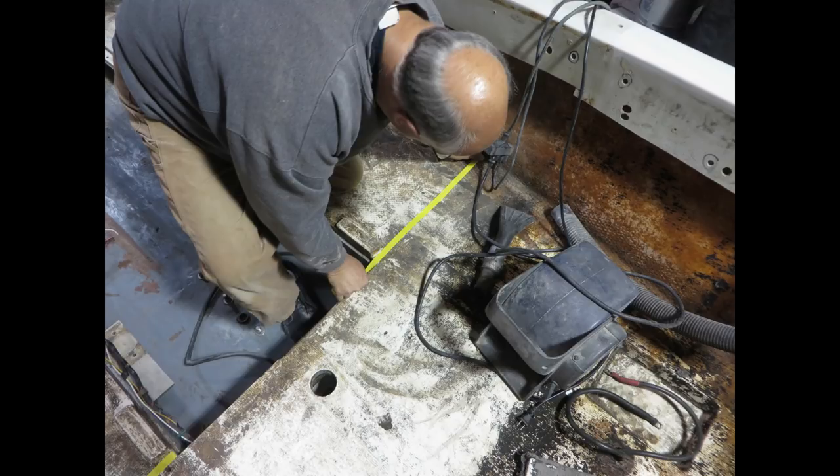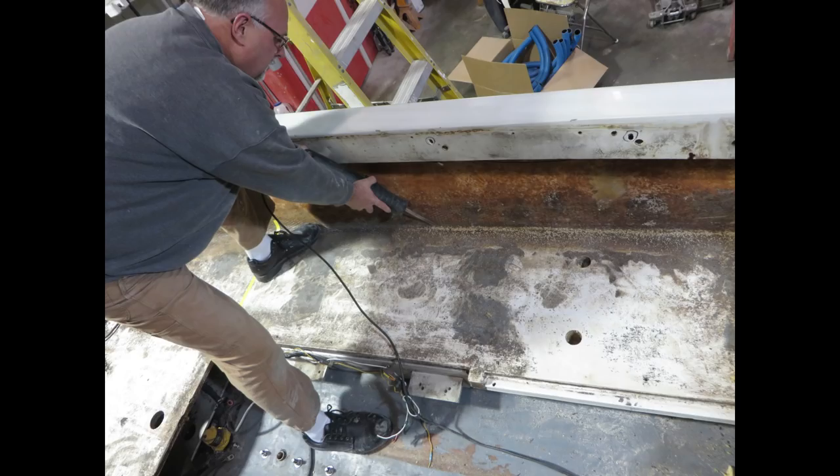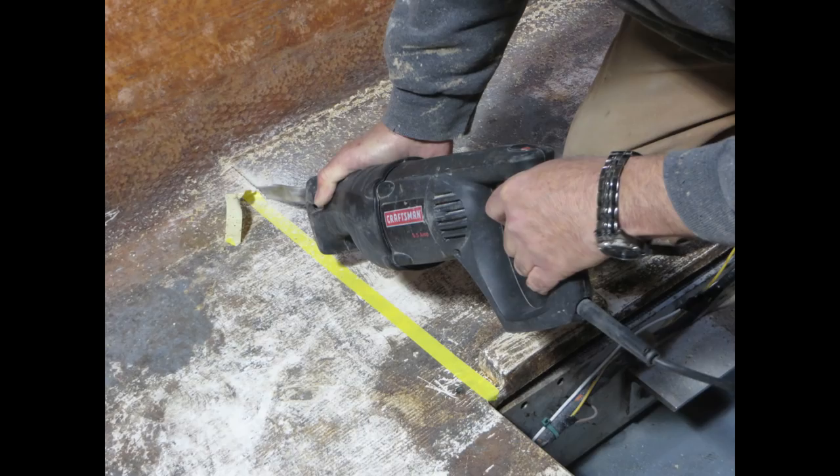Here I am marking where I'm going to cut the floors — I'm going to do this on both the port and the starboard side. Cutting along the hull sides will go pretty fast. Make sure all the screws have been removed that are attaching the floor to the stringer system. Again, when cutting across the floor, make sure you float the blade over the top of the stringer so you're not cutting the stringers. When locating the screws holding the floor down, you may want to snap a chalk line so that you know exactly where that stringer is.